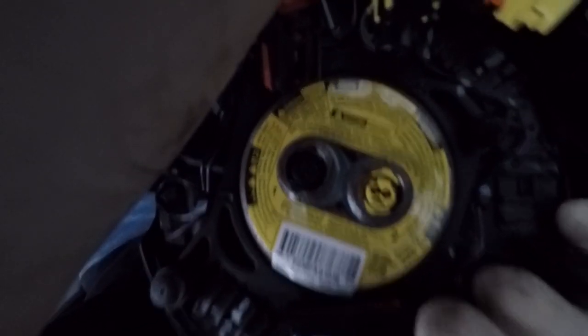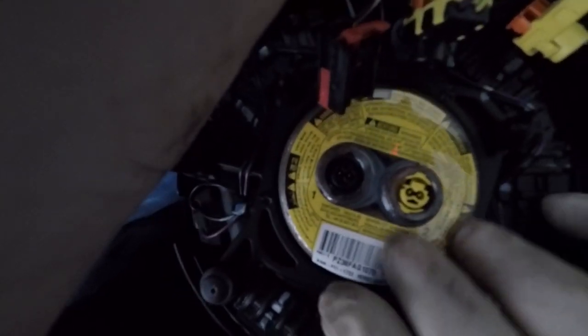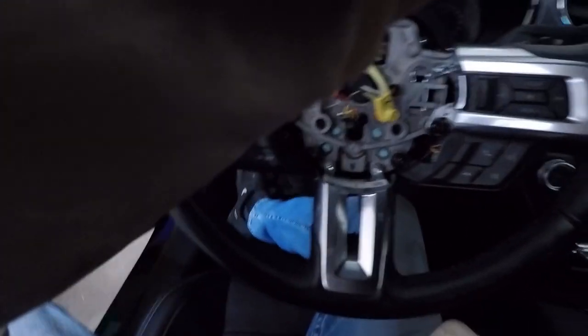For the other two connectors, they have a little orange clip on top — go ahead and pop that out with your pick and just pop them up. Once you pop them up, the entire clip comes out of place. There's one and there's the other one. As you can see, you've got the yellow one out and the black one on this side. These are color coded — black goes with black, yellow goes with yellow. Then you can go ahead and remove the airbag and set it out of the way.